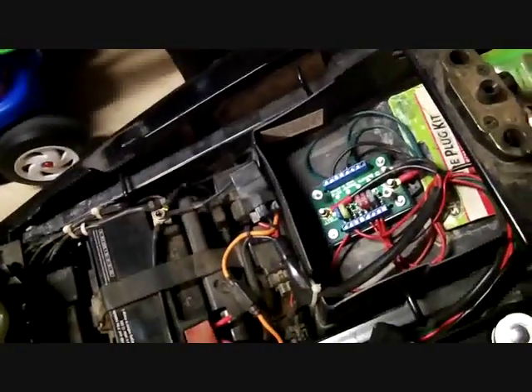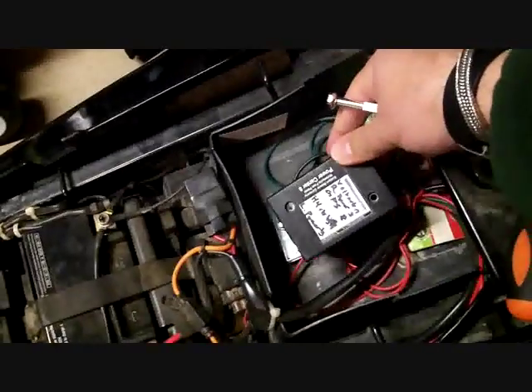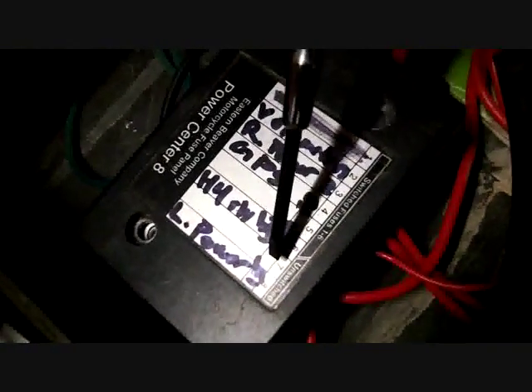I took the seat off of the bike, and I have my Eastern Beaver power fuse block set up right here. As you can see, I still had a few spaces. These are the switched fuses and these are the two unswitched fuses. The first unswitched kind of crept out on me a few months ago, so that's kind of out of commission. I had my Eastern Beaver H4 headlight relay in that opening, so I moved it over to switched fuse number 6. I learned from the forum, Grey Wolf, that you can actually plug it into the unswitched side because the lights are managed directly by the bike stock harness.